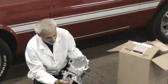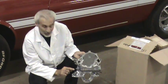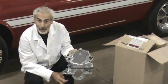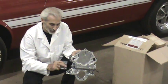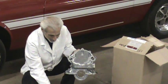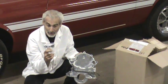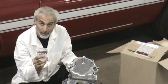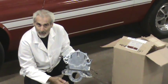They've made pretty much an exact reproduction of this thing. It's got a correct Ford part number on it. It's got an area here for the dipstick to be slid into. If you don't have a dipstick because it's maybe an 80's Mustang, they give you a nice little plug to put inside the dipstick tube hole. If yours has the indicator pointer on it — an early Mustang — this is pretty critical. They even include the timing pointer which attaches to the side of this thing. So they've really thought about everything when they made this part.